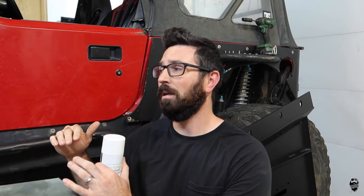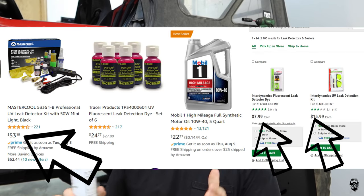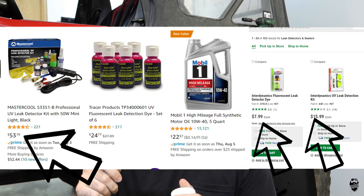There are several ways to diagnose an oil leak — engine, transmission, AC system, power steering — any oil system. The main way is a dye: you pour the dye in, run the vehicle, put your UV goggles and UV light on, and figure out where the oil leak is coming from. That's how we diagnosed oil leaks at the dealership, but it will cost you probably between $20 and $60 depending on the quality of UV light, dye, and glasses.